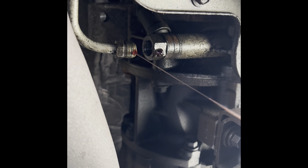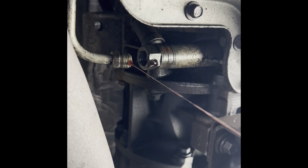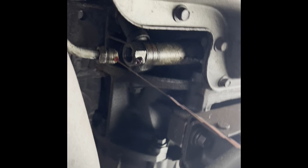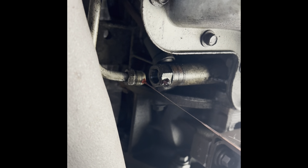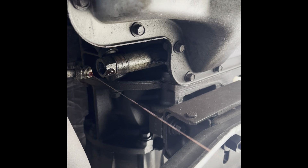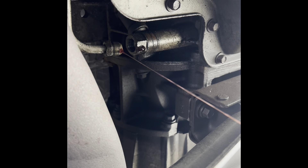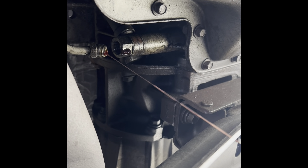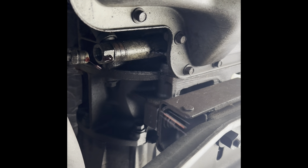Alright fellas, I'm in the back now — I'm under the truck on the passenger side of the transmission. There's one of the cooling lines, the one further back. Same wrench — either the 5/8 or 16 millimeter line wrench. I pre-soaked these so they're definitely coming out easy — I recommend you do the same. Always have a container because you're going to make a mess. Take your time, especially if you're doing it on a nice floor.